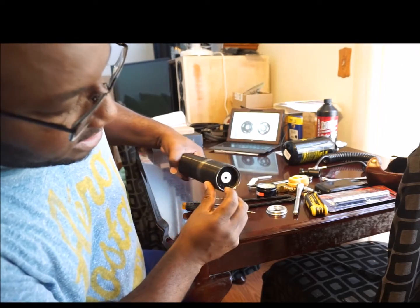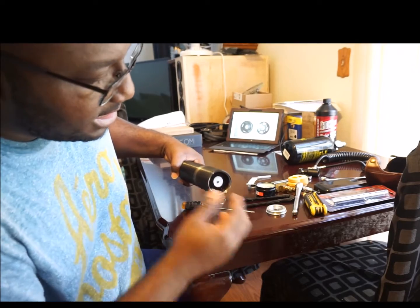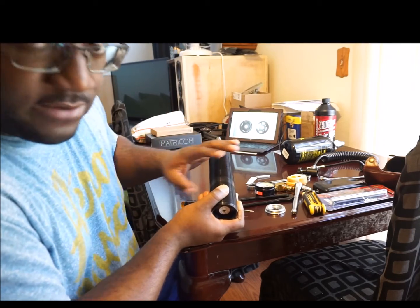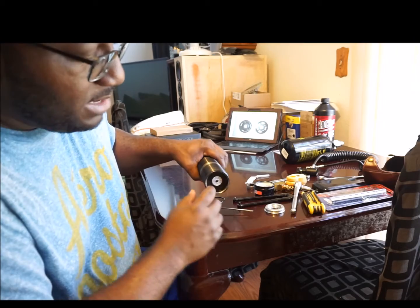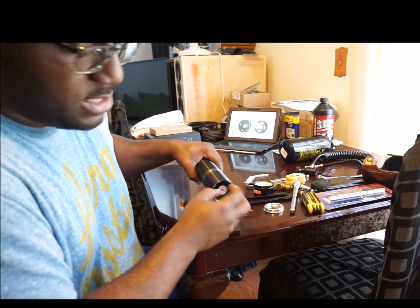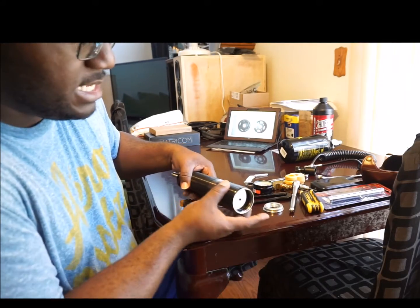There's also another c-clip on the bottom — the butt plate or stop plate of the shock. The reason this went in is because earlier off camera there was vacuum inside and it kind of lifted this up. I'm going to keep this c-clip in for now — you can take it out, but just know that once you do and you push down, this will pop out and oil will spill everywhere along with the sliding piston that's inside.